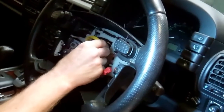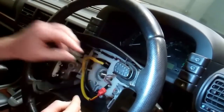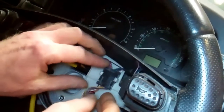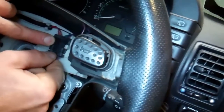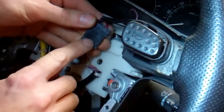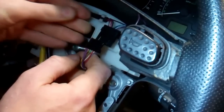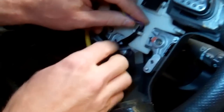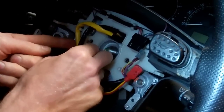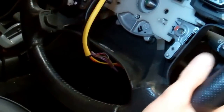Once it's loose, remove the nut and put it somewhere safe. Now we need to remove the connections. It's difficult to unplug the connector in the slip ring, so it's easier to disconnect the connector on the wheel side. Move the little white tab to the side and pop the connector out. Flip it over — there's a peg you can't release, so just pull it free. The black cable goes on the inner track and the yellow one goes on the outer track.